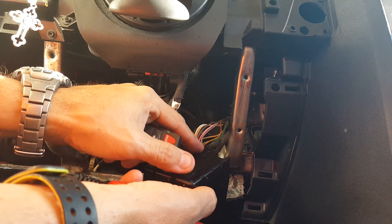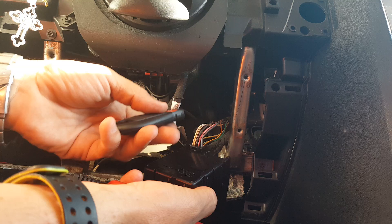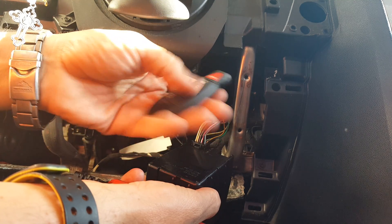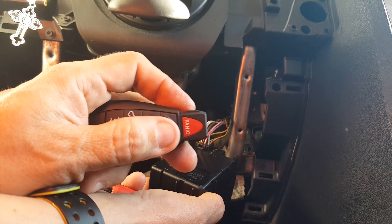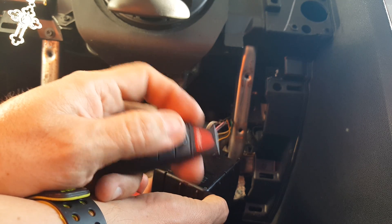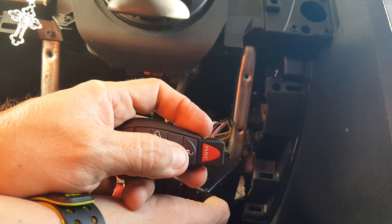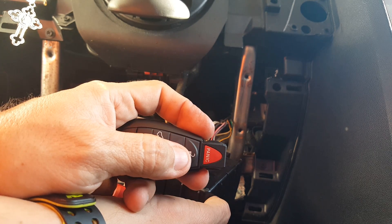The reason for this video is: if your remote stopped working months or years ago, or it's not working at all, come here and test — if you have power on the blue with red stripe and ground on the black wire, that means your remote is not working and you have a problem with the WIN module, or it might just be the remote that needs replacing. Before spending money on additional fob remotes, send me a text with the symptoms and we'll help you find the best solution. Sometimes going to the dealership incurs more charges, and we can give you a less expensive solution. They all come with a one-year warranty. Thanks for watching.